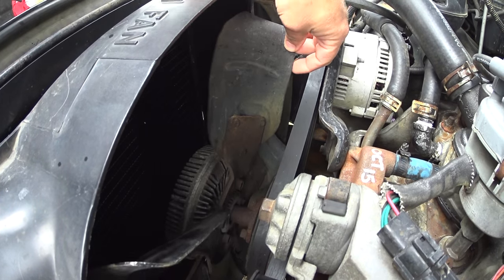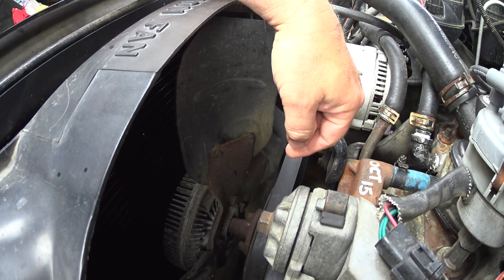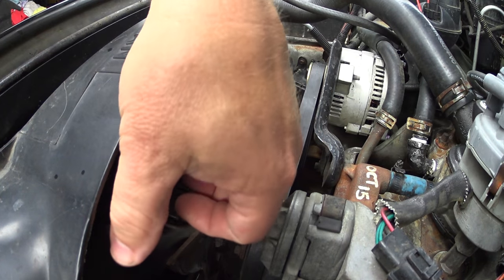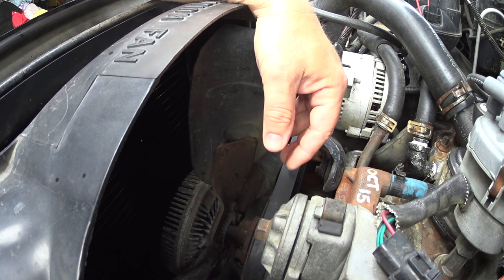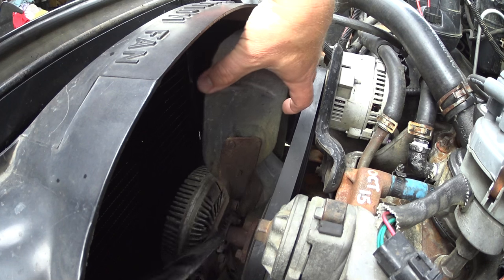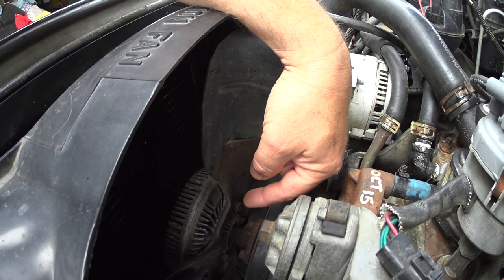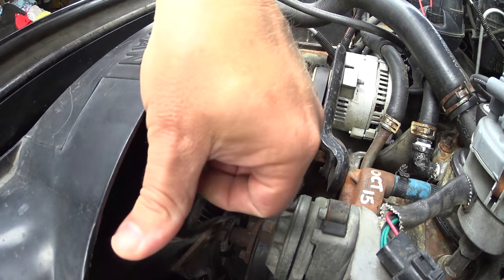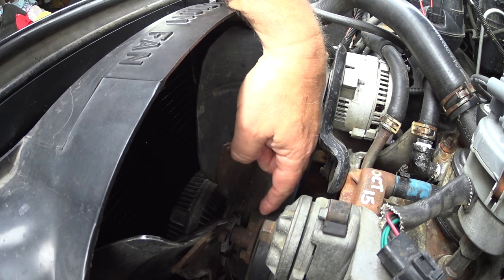So what am I doing on my truck? I'm working on my fan clutch. Basically, whenever your engine's running, to save horsepower, they allow this fan to kind of slip. It doesn't get driven directly. Inside there's a little element on the front of the fan that, based on the air temperature coming through the radiator, allows the fan to slip — it's a viscous fluid inside, silicone in this case. At cooler temperatures, the fluid stays in the reservoir and allows the fan to be driven at a very low speed compared to the RPM of the water pump shaft.